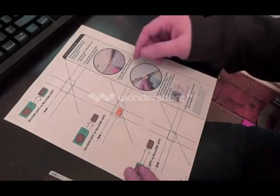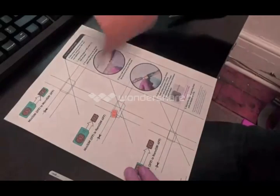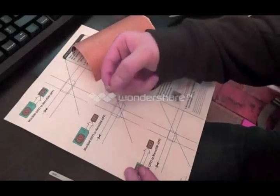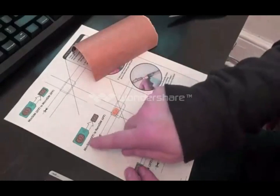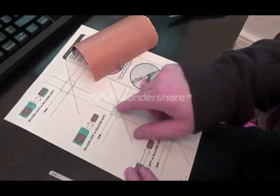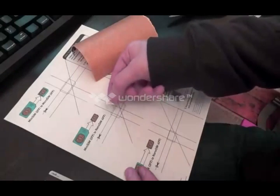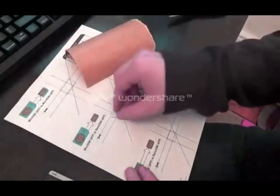Now the next step actually requires a little bit of sanding, because the last thing that needs to happen is you need to decrease the thickness of the actual card. A mini SIM is slightly thicker than a nano SIM, so you need to go onto the back side where the plastic is and grind off some of the plastic. Not very much. You just want to rub it, just gently, and then go into the tray.